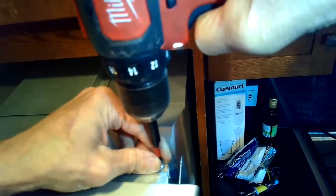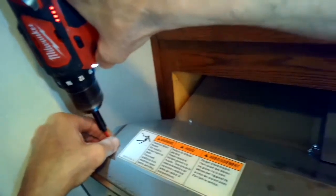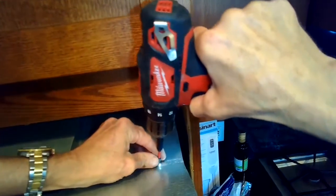We're going to pull it out toward us. The broil element was stuck on full blast because the relay was just locked in the full-on position, so every time you turn the oven on the broil just goes full blast. The F10 kicks in and it starts beeping and beeping until you turn off the breaker. So we're going to remove this upper panel on the front — really easy to do, just four or five Phillips head screws holding it in, and right underneath is the relay board.